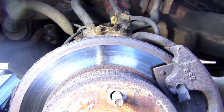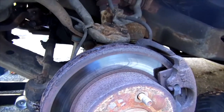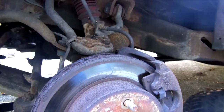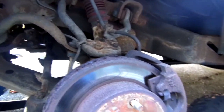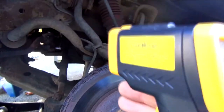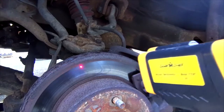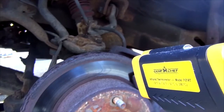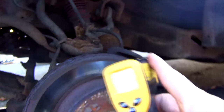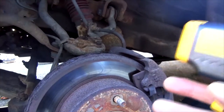I'm going to remove this and show you bits and pieces. The reason I was showing you the laser thermometer is because I thought I had a sticking caliper on one side — I was getting a little bit of grinding noise. That grinding noise was most likely happening because the brakes were chewing more at the top.